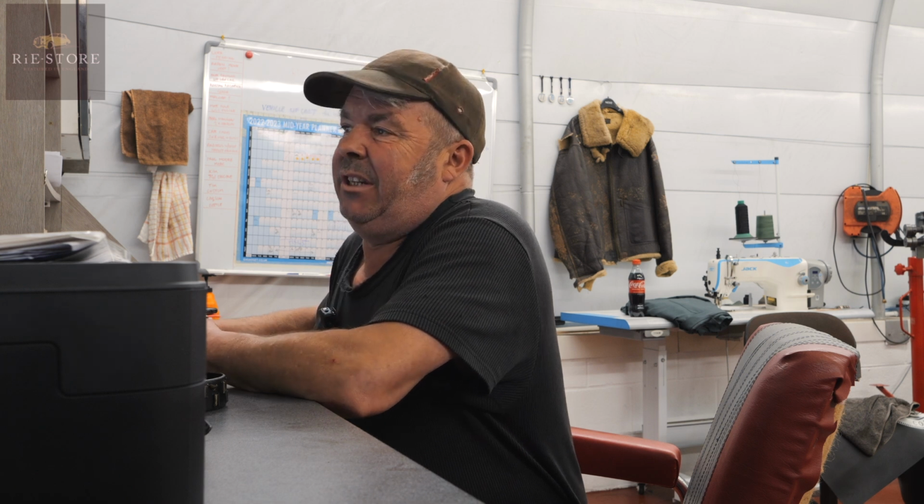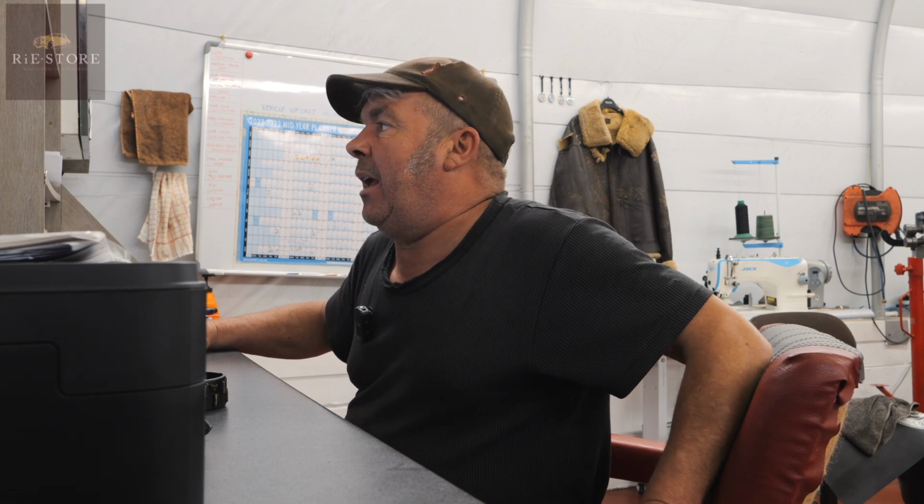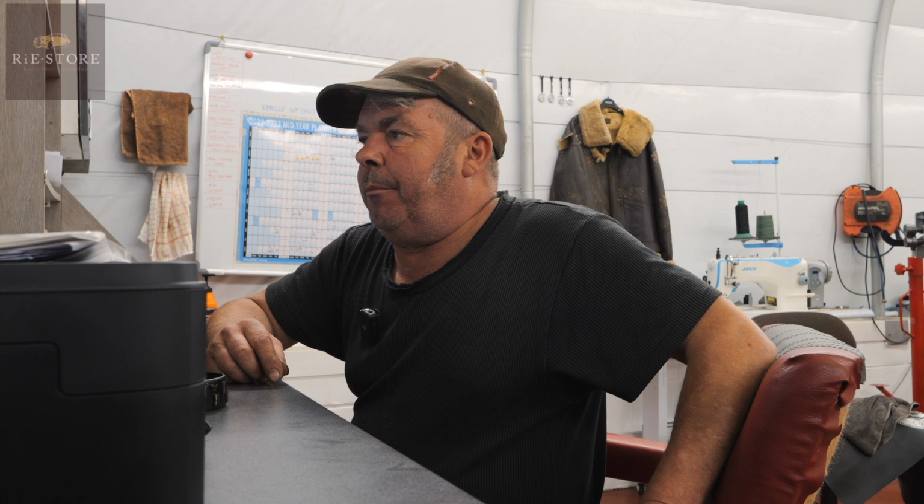5 bar is 72. Anything above 50 is alright, realistically. If it's all brand spanking new, you'll get probably 65 out of it. But anything lower than 50, you need to have a look at it. But 5 to 1 is so low. Your average one of these is just an old V8 engine, probably 9 to 1.